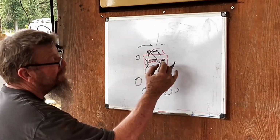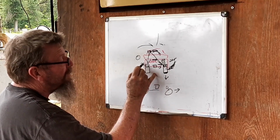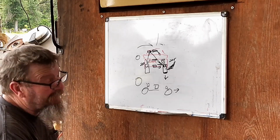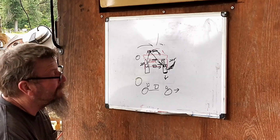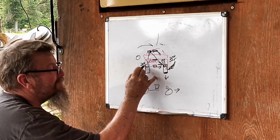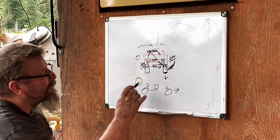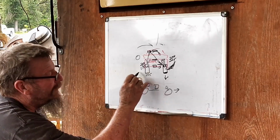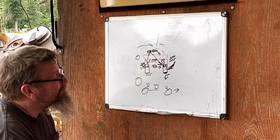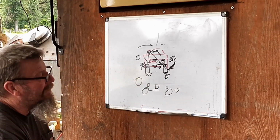I run the 225 on the right rear and the 200 on the left rear. And if leaf springs were cheap, I wouldn't be afraid of trying a 250 and 175 on it. I would kind of like to see what that did. Always, before driving for other people, we always ran the 225 on the left rear, 200 on the right rear. But I really like it with those swapped, with the 200 on the left rear.